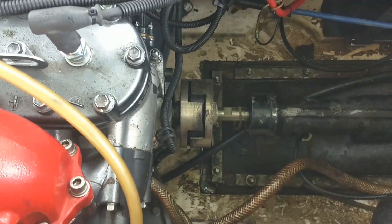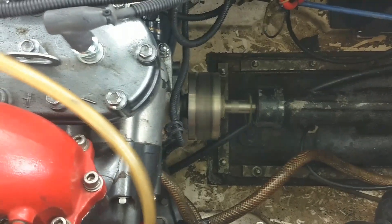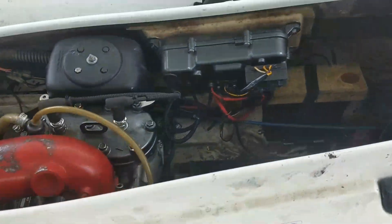I think we're shimmed in pretty good — we'll put it back together and start it up and see. Got the new coupler installed. Hopefully it works out well. We'll find out if machining down the Yamaha coupler is an acceptable solution for the Tiger Shark, because replacing it with an old eBay part with unknown hours of use just didn't seem like a very good idea. We'll find out when I test it out. In the meantime, keep it smoky.